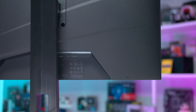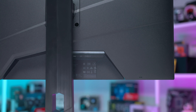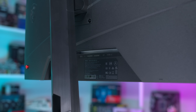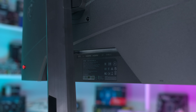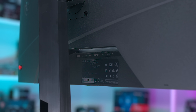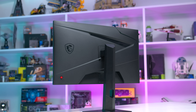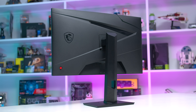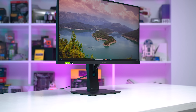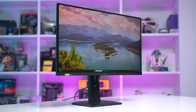The port selection on the rear includes one DisplayPort 1.4, two HDMI 2.0 ports and a USB Type-C port with DP alt mode support. Unfortunately, as the HDMI ports are not 2.1 spec, they cap out at 1440p 144Hz — ideally they should be HDMI 2.1 to allow for the full refresh rate over HDMI, although it's a non-issue for the DisplayPort. There are no additional USB ports, so this is one of the rare new MSI monitors not to feature a KVM switch, something that was omitted for cost reasons.